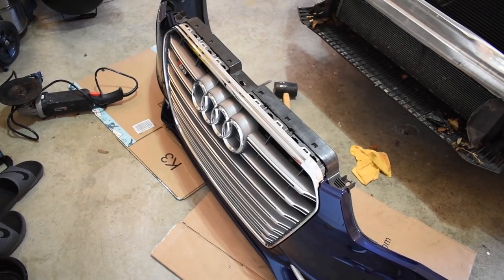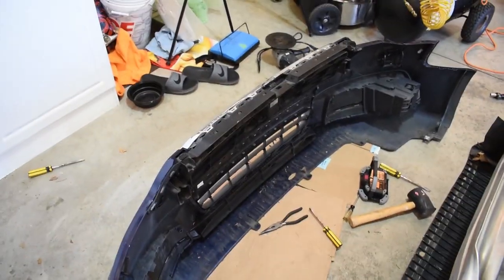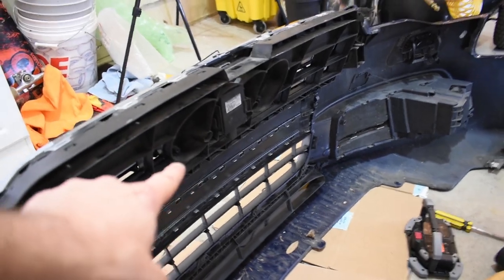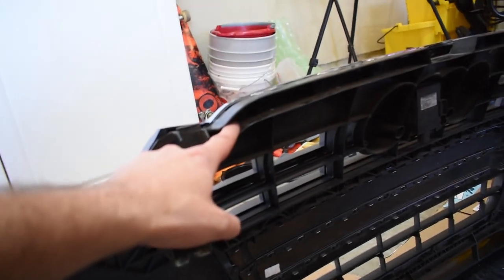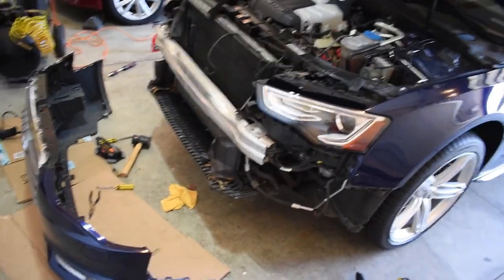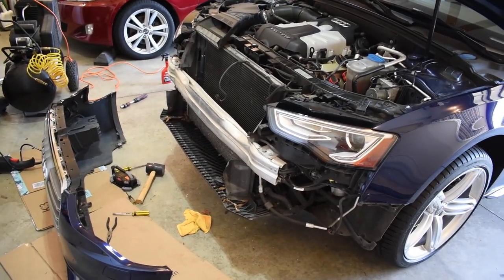All right, as you can see, I got the new grill on there. And I got it all clipped and screwed in, so it's really nice. It's gonna make a huge difference on the car. One thing to note, all these screws on here, I already mentioned the two sneaky ones behind the logo, but there's two shorter screws, and I believe they're the corner ones. So the top corners have the two shorter screws of the bunch. So I'm gonna continue cleaning up this inside, and then I'm gonna put everything together just in reverse. And then I'll show you the finished product. So we'll see you later.